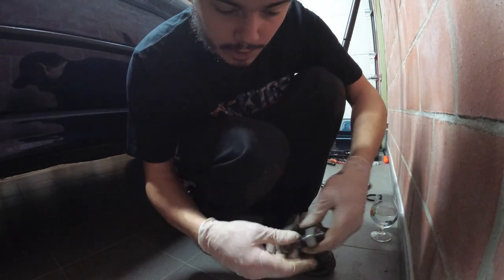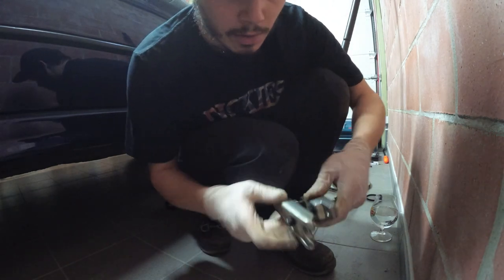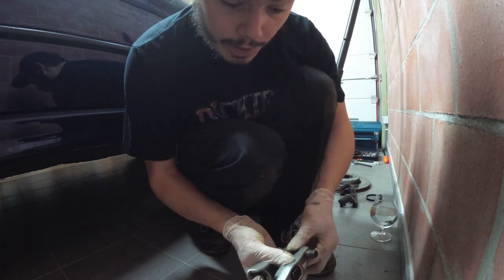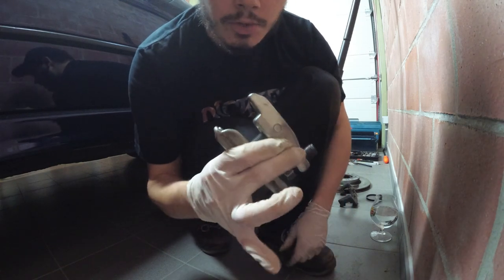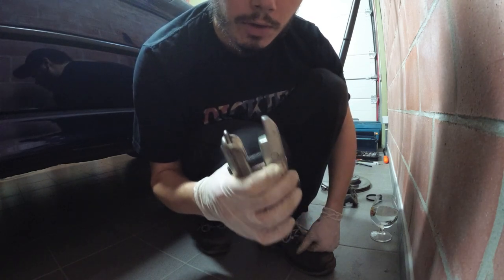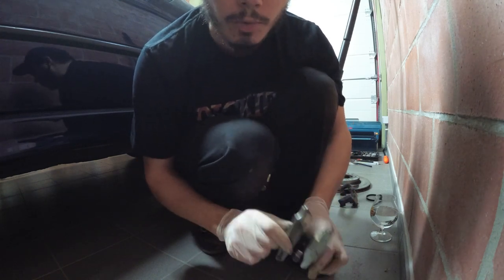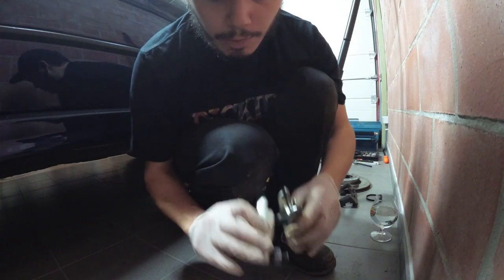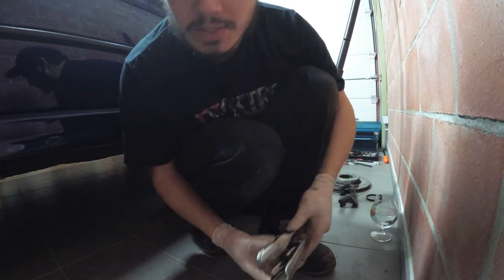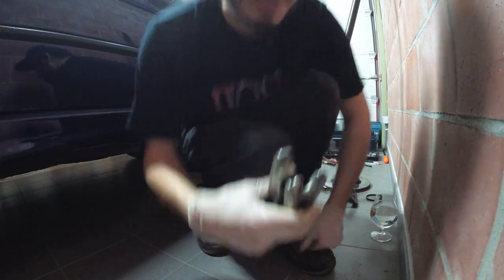Not sure how good you can see me, but this tool right here is pretty crucial to the job. I just hammered like two or three times but gave up — last time it didn't work either. This is to get your tie rod ends off of the knuckle. You can always try this one for the lower control arms and the knuckles, but this is a pretty small one. I also have a bigger one — the bigger one I broke, well the threads are a little stripped, so I'll just remove the knuckle and lower control arm as I did for the other side. I'll try this one for the tie rods — it'll pretty much work.